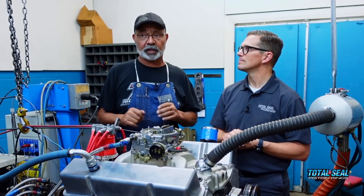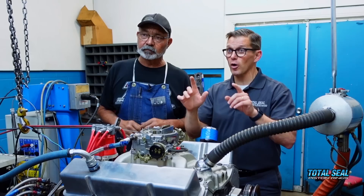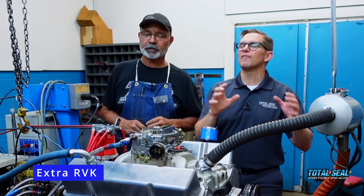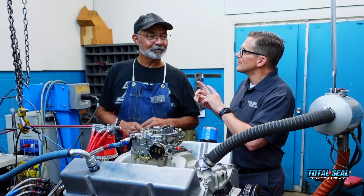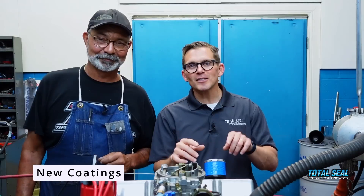We're going to continue as Total Seal progresses on their products — we're going to keep doing this and keep striving to get a little bit better. The other lesson from this really is: thinner rings give you power, efficiency, lower engine temperature — that's great. But you also need to think about the hone. If we learn nothing else from this test, the hone job that Brad was able to do using the diamonds — getting it straighter and rounder, having the right piston-to-wall clearance, and most importantly having that extra RVK to get it to seal up better — that made a huge difference. Hone, ring — it's that ring-sealed soup we always talk about. It's a system. Your fuel, your oil, your rings, the hone — you've got to get that ring-sealed soup right, and that's really what we saw today. There's more to come — we're working on some new coatings, so next time we're back here we'll play with those and let you know.